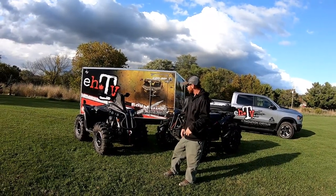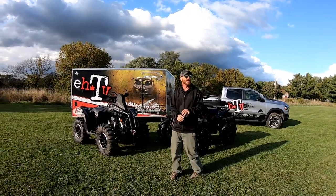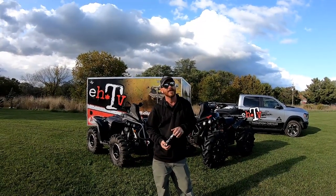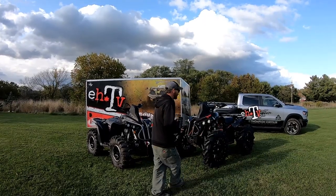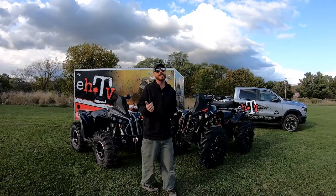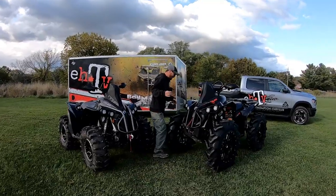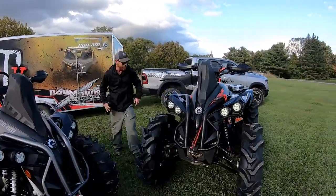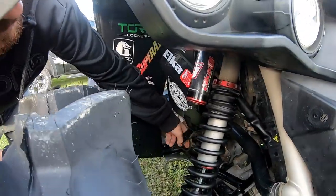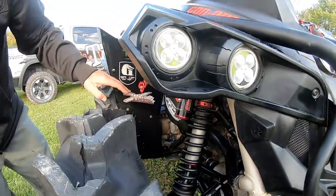Basic though, for the most part, I have noticed already that with the 18s and the 17s, I think even the 16s, almost every bike I've ever seen, all the boys riding, all the XMRs, all the Outlanders, there was a bit of an issue with the ceramic seal. Now, it wasn't much of an issue. Unless you're getting coolant into your engine side, it's not really an issue. But these ceramic seals of the water pump housing tend to weep a little into this vent line here at the front. And I'm sure, yeah, we do. We got some coolant in here. She's a little dirty from the mud and dust that's collected in the line and funneling down. But we got a little fluid there. And after every ride, I usually empty it out, there's about an inch of coolant in there.